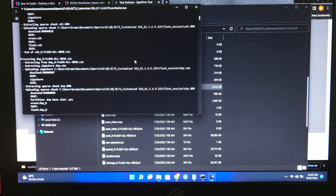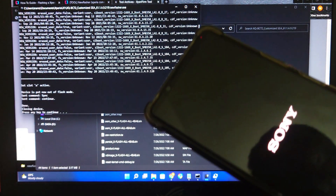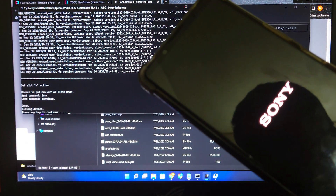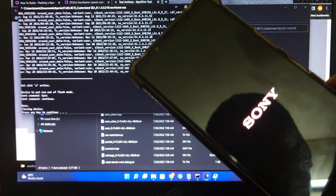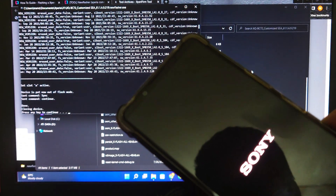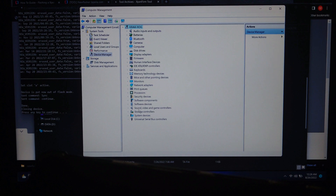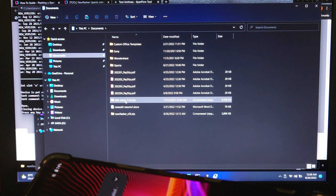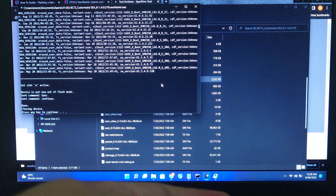I'll cut the video during flashing and come back when it ends. Once finished, you'll see the phone restarting. Check that it shows 'set slot A active' — if it shows slot B, you'll have extra steps to revive the phone. Also, while waiting for the boot, make sure you have ADB installed, otherwise you'll see an exclamation point and fast boot won't work properly.